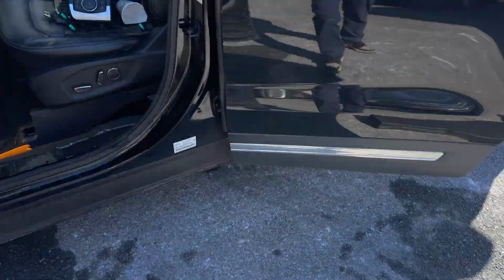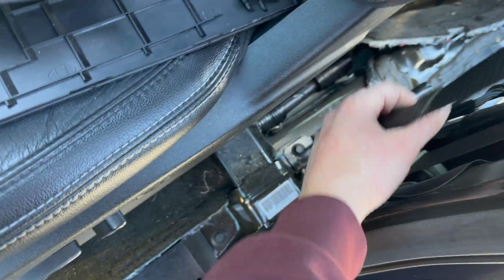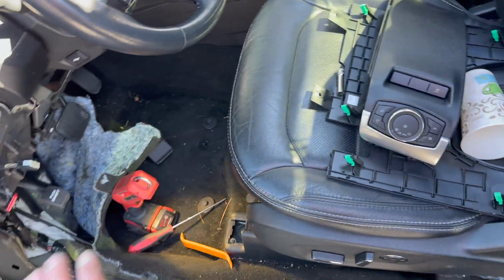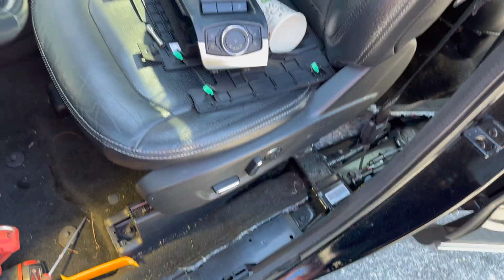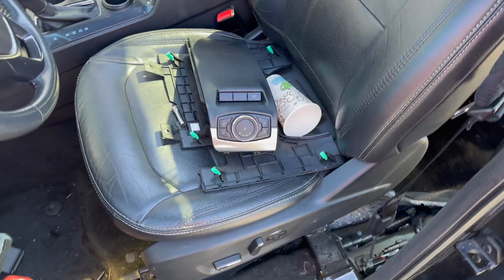Here we go. Battery disconnected. Now we're good to go to disconnect any connector, any seat. Disconnect whatever you want. You are safe, and that's the best you can do. Don't forget, any time you're working on an electrical compartment, to disconnect the battery.